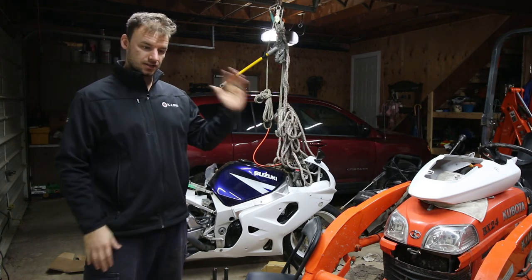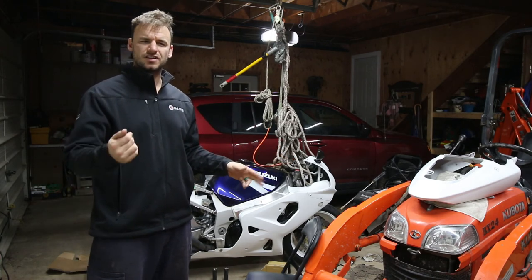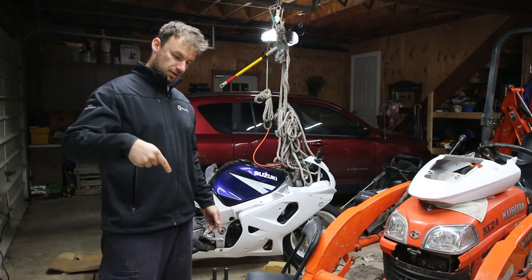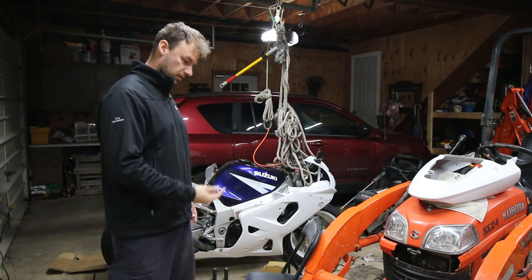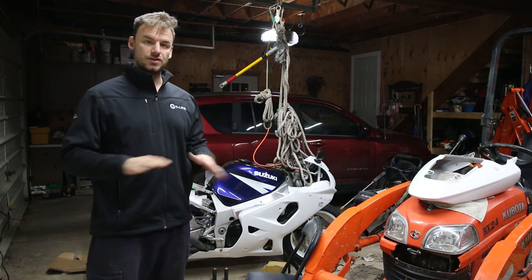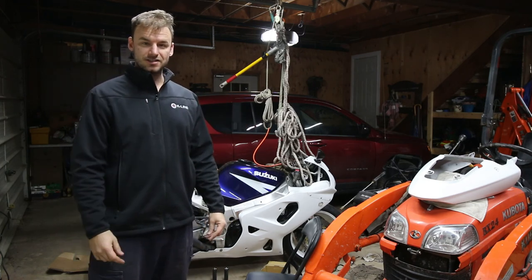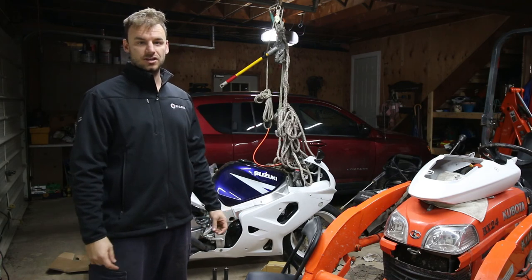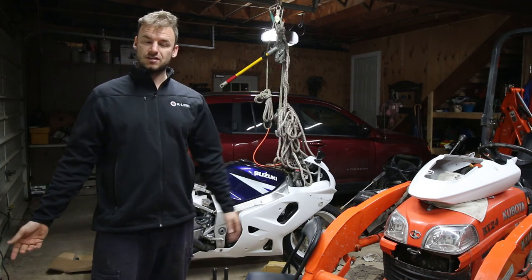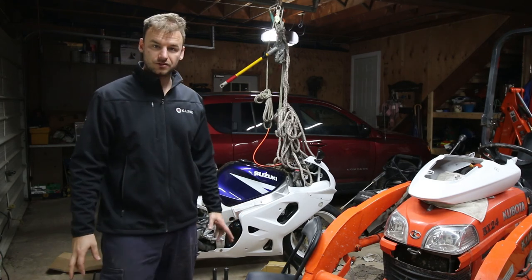So that's the brakes done. I will do another video on bleeding the brakes. I've got this Phoenix Systems reverse brake bleeder — you basically pump new fluid through a pressure gun, through the caliper, up through the lines, and then through the reservoir. So it basically eliminates all the air and it's supposed to be like the cat's meow. So check that video out, guys. If you own an early series Gixxer, like a 750, 1000, or 600 from 2001 to 2003, consider subscribing.